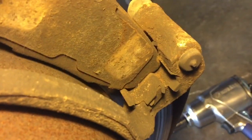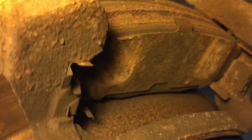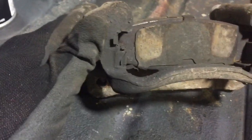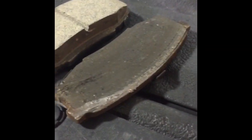Next step is to take off this bolt and this one down here — both 17s just like the last ones — and that will remove the whole caliper bracket. Rather than trying to dig the pads off because there are little clips and they're kind of rust-welded in place, I'm just going to pull the whole bracket out and then hammer the pads out. One pad has got plenty of meat; the other pad is a different story. Side note: 94,000 miles on the original pads — it just hit the squealers. Big-time difference versus a new pad.